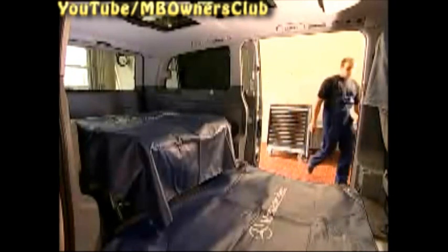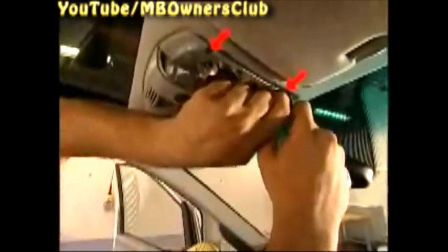We start with the control device of the roof operating unit. With a long wedge, remove the plastic cover. Then unlock both fastening clips and separate the 4 electric connections.